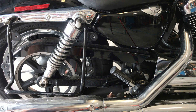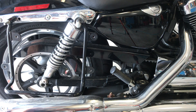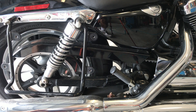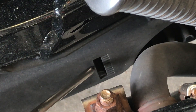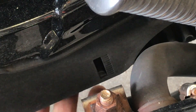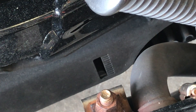Next on the list is the drive belt. It is utmost important to have the right tension on this drive belt. To check that, you can quickly go right here — I like to see 3/8s. They have a scale on the belt guard that I'll show you now, but this is a quick reference. Right there, you know you're where you need to be. I'm going to show you a spot — it's hidden but it is there. This little scale is hidden by your exhaust. You'd have to get very low on your motorcycle to see this, or at this angle on a seat — you'll never see how your belt tension is. So you have to lay down and just take it, and you'll see there's a scale. I like to see quarter inch to 3/8s. I have a video on how to adjust your drive pulley belt.